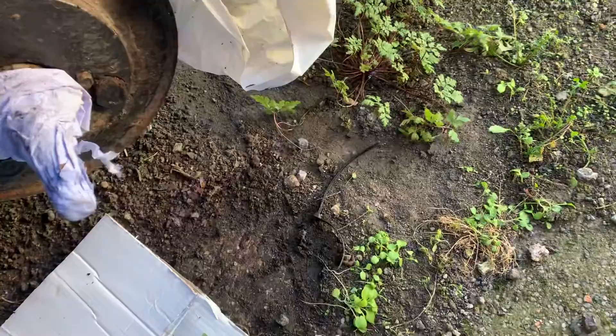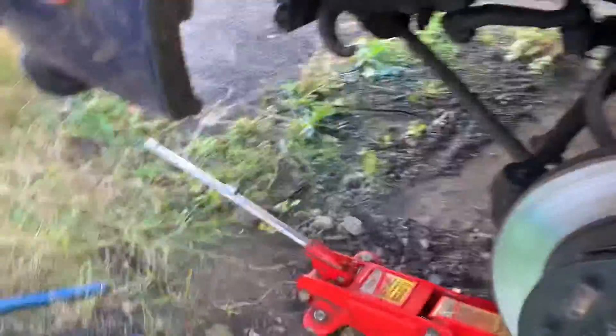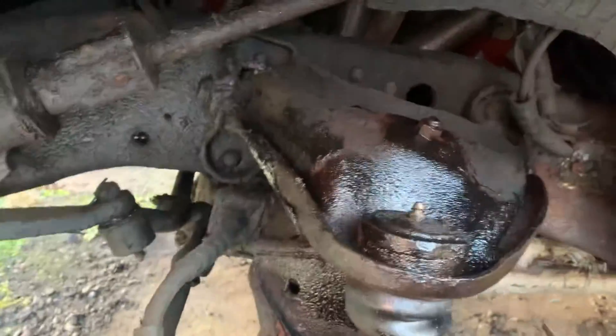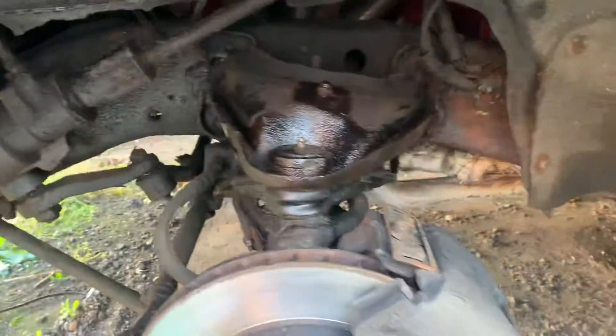Stripped all this off ready to work on it. This will all be cleaned up, and you can see how rough it is. When it's done it's all going to be painted up, because it stops further corrosion. The struts are painted, this is all heat paint as well. This here will just be underseal because that's really thick metal — there's no problem at all with that.